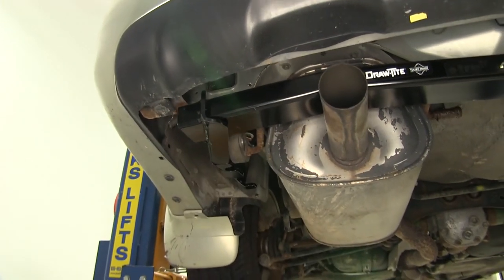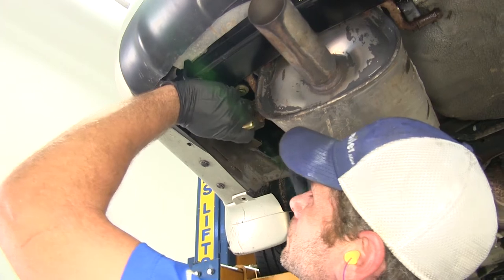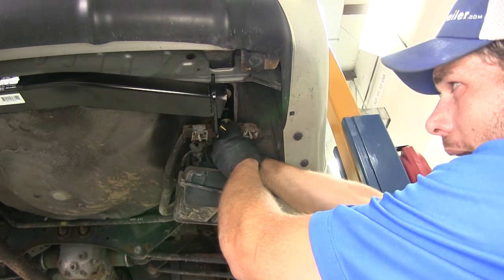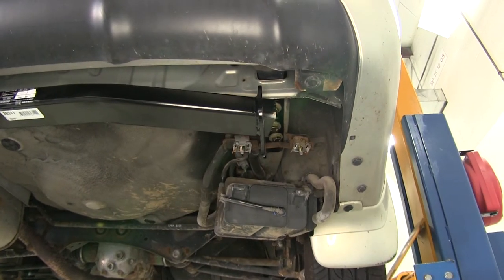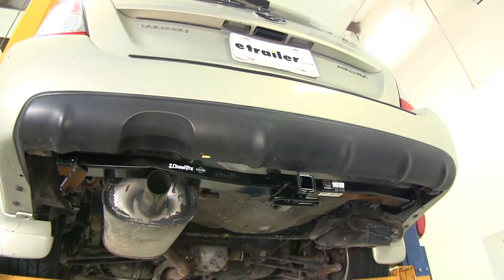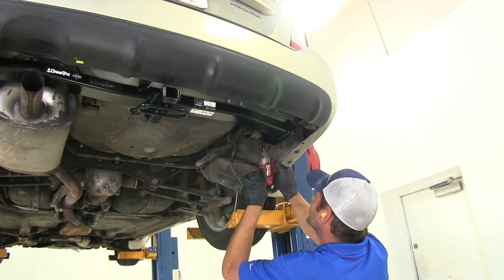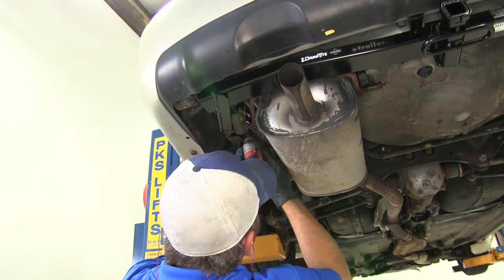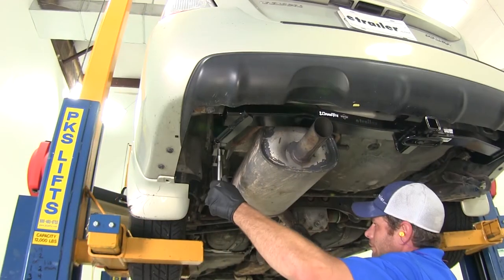With both sides started, our hitch will be held in position. We'll grab our other five fasteners and get those put in place, making sure the forward bolt on this side passes through both our hitch bracket and our canister bracket. Once they're all started, take a quick look to confirm the hitch is centered. Then start snugging down our fasteners. Now we need to look in our instructions for the torque specifications — we want to get all of our fasteners torqued down appropriately.